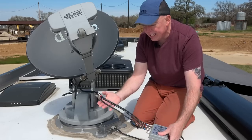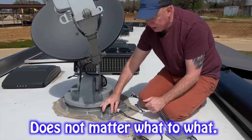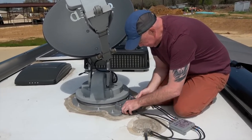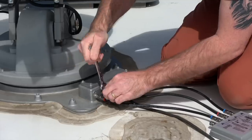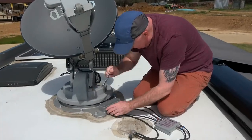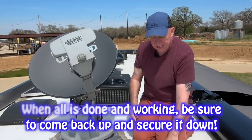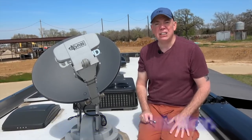So it's as simple as that. Now you're just taking these three wires — there was a cap on here that I took off because normally there's only two hooked up, so I removed the cap already. You're just going to hook these three wires up to here with a 7/16 wrench. And that's it. We just converted the top section of the motor coach — the Dish Network with the LNBs — into a Hopper 3 compatible system. So we'll go inside now and see if it actually works.